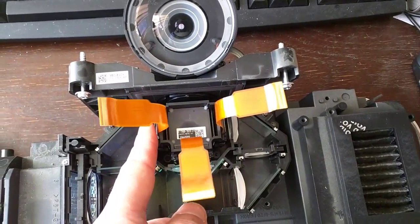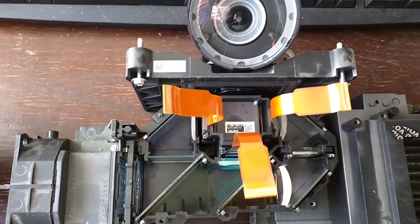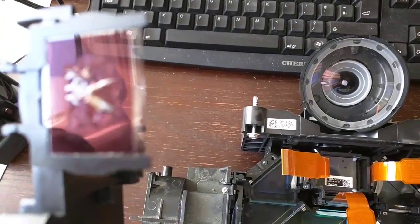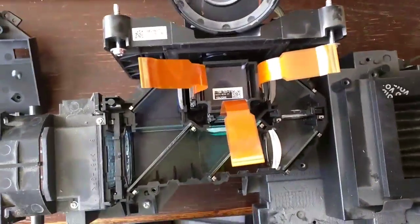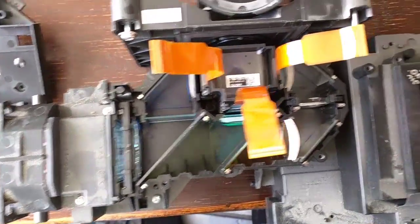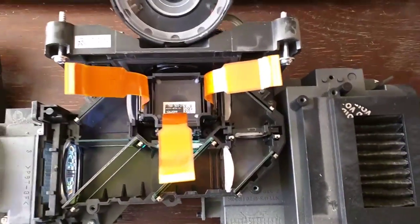Three LCDs make the image, and you can see this blue one is burnt — it's hard to focus on that. This is a common fault and really a very poor piece of design, because that's the one closest to the lamp and the one that gets too hot, which makes it uneconomically repairable.